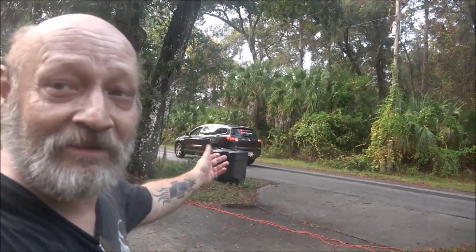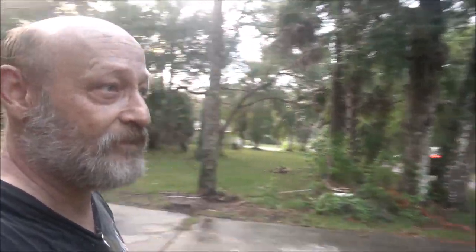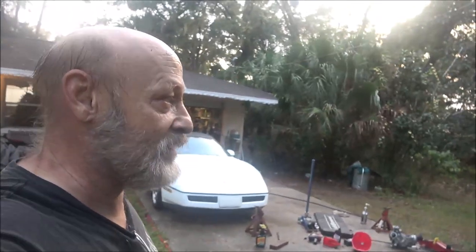That didn't make that clink noise. Usually every time you hear that thump, thump, thump, thump. I think I mentioned it a couple times in a video. I'm like, did you guys hear that? So that could be what it was doing, just traveling down the drive line, making it sound like the rear end. But regardless, I've got enough gear lube. I'm going to go ahead and change the gear lube in the rear differential, just in case. That way I can see what it looks like.